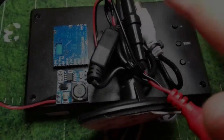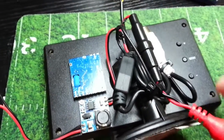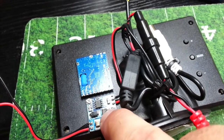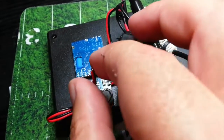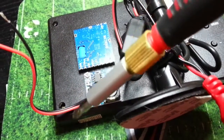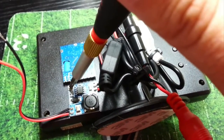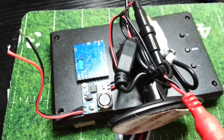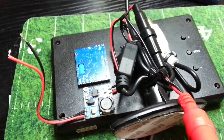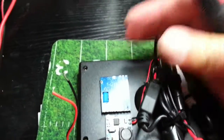I've got it disconnected here. I tapped 12 volts from here, went through the fuse, then tapped some wires and brought them into a voltage regulator. This is the output of the voltage regulator, and this little adjustment here I've set to 5 volts. So the output on these wires is now 5 volts — as long as the input is bigger than 5 volts, the output will be 5 volts. I've cable-tied the whole lot to keep it neat.